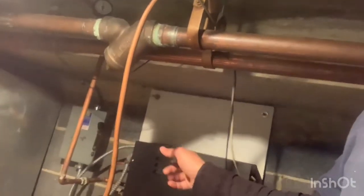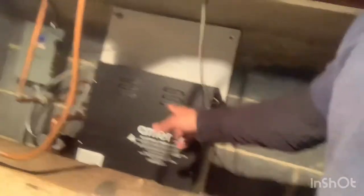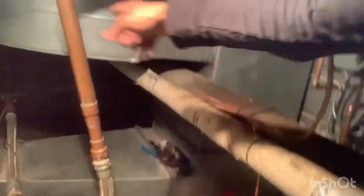Basically, you run your power up here, connect it right there, then jump it into the system. Everything comes in — water powers up the drain pump, which is hiding right there, that black thing. That's your drain pump; it pushes water out with pressure to empty it quicker. This right here is your water in — it goes all the way down right there. Follow this path and it takes it down to where the filter is. We put the filter down there because we can change it faster — I'm basically crouching in this attic space where the ceiling is literally right under me.